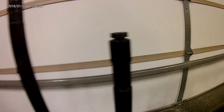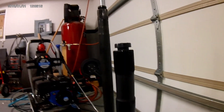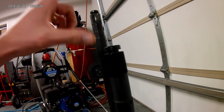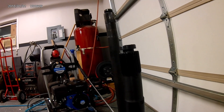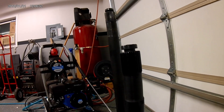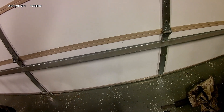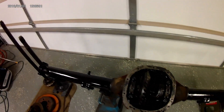I wanted to show a quick example of the difference — my new axle versus the old axle. My first step was to measure both, find the difference, and then cut down both sides. This rear end's axles were both the same length, so that was easy. The Summit kit has equal-length axles. Other things we checked: flange width beforehand, and the play in this bearing — it has an in-and-out tolerance that's also in my chart.